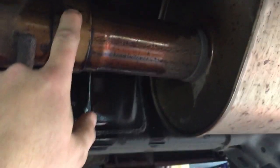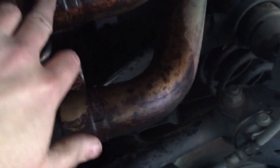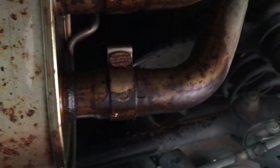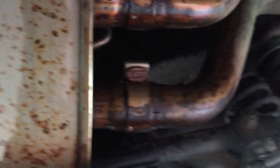Bobby, it's time to take this Ram from a boy's truck to a man's truck. Okay folks, we're underneath the vehicle. Here's our stock muffler. Looks like we have a clamp here — 15 millimeter socket on the impact — and we have two more clamps back here, also 15 millimeters. We'll unbolt them, get the muffler down low, and get it off.